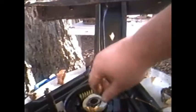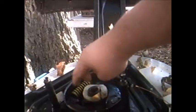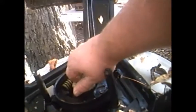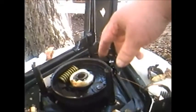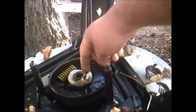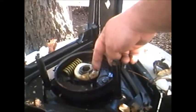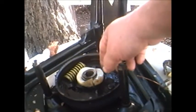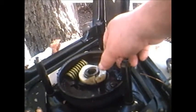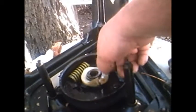There's your basket drive right there. Now, when that motor goes in one direction, this stays locked down, and the tub can't move, therefore the clothes don't get knotted up. When the motor goes the opposite direction to pump and spin, then it catches on this little edge of this thing right here is called the drive basket cam actuator or some such.